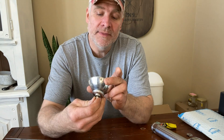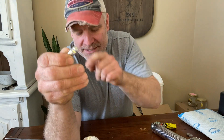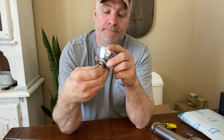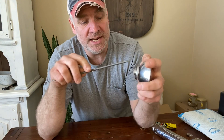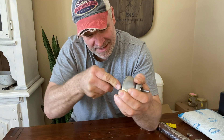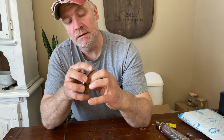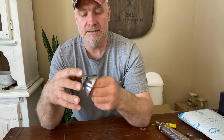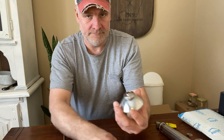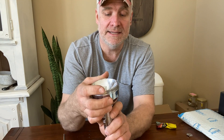Now that you look at it, it looks the same. We are just going to put the bulb in — and it doesn't fit. They made this aluminum piece too big to fit into the opening, so what I'm going to do is use a chainsaw file and just open that up a little bit. Okay, it's in! So there you go — it is in now. We get our little glass insulator and screw that in. It fits in there good; it's kind of unfortunate I had to file it, but it ain't coming out. So we're going to throw that back into the flashlight.